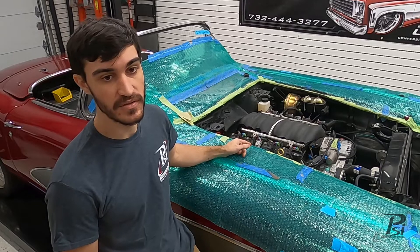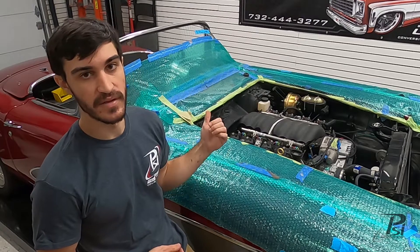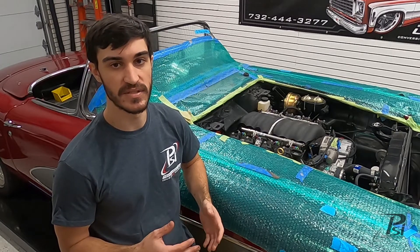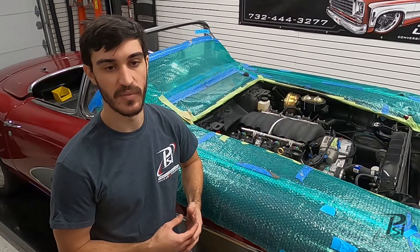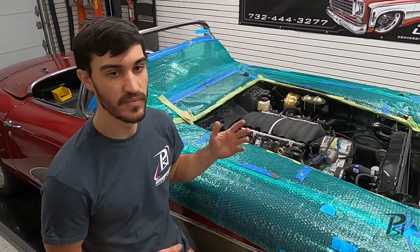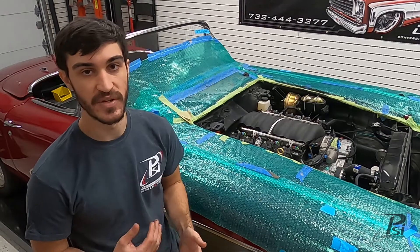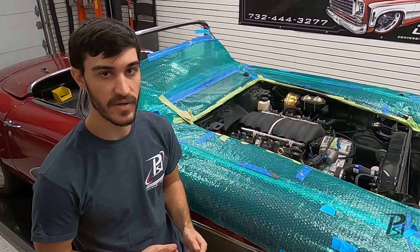We've got the engine harness installed. A couple of quick tips about getting it run into the engine bay: first, make sure you avoid any sharp edges or getting caught on things. If you do get caught, take a second and figure out where it is — don't just yank on the harness; you don't want to accidentally pull a connector off or break a wire. Be gentle and patient. If you have two people it will be much easier. Also make sure you deburr the hole you drill so nothing gets caught on that.